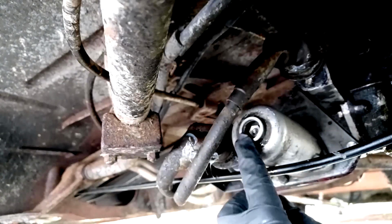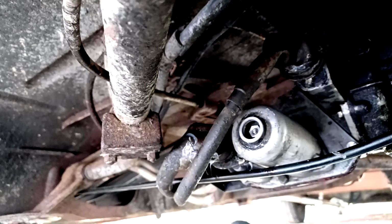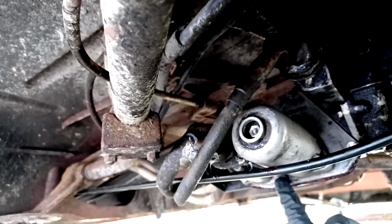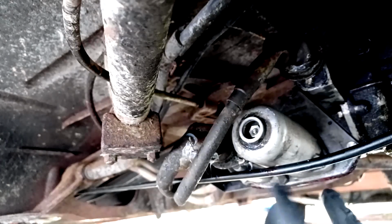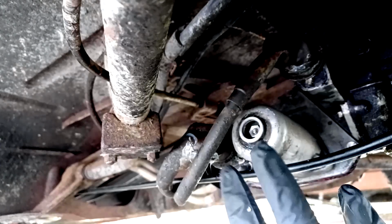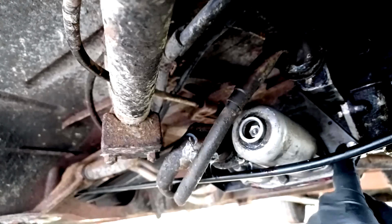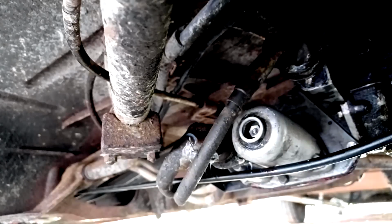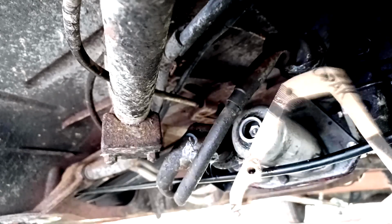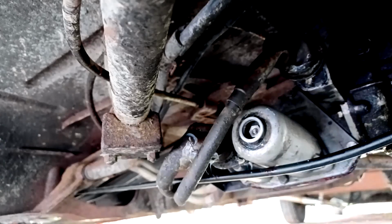So there's a, oh, you can see it. Okay, there's a little bolt in there. So I put it all back together after that last clip. When I had it working in that clip, I only had this bolt in it, and no other bolts. It was just in there, you know, snugly, but nothing else, not clamping it. As soon as I put it all back together, it locked up. So maybe it's not a thick enough gasket, possibly. I made another one. I'm just going to double up the gasket and see. I don't know, maybe it's 15 thousandths maybe.